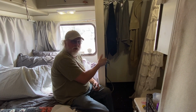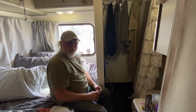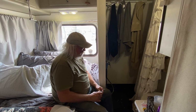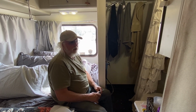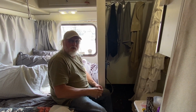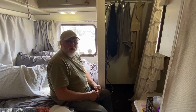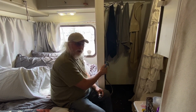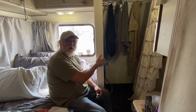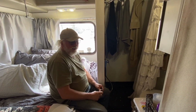But first we want to make sure we got the leak problem fixed, and we'll deal with that a little later on. Okay, and for that to have rotted out, about how long do you think that's been leaking? The amount of rot I'm seeing, and with, you know, being an RV is not always used, the shower is not always used, it's been parked at different times before you got it. I'm guessing probably several years now. It's quite a bit of damage. We might have some warping and staining from, you know, the little bit of time you've been noticing it was getting on the floor, but I think it's probably been leaking in the wall for quite a while. So thank you, Robert. Yeah.